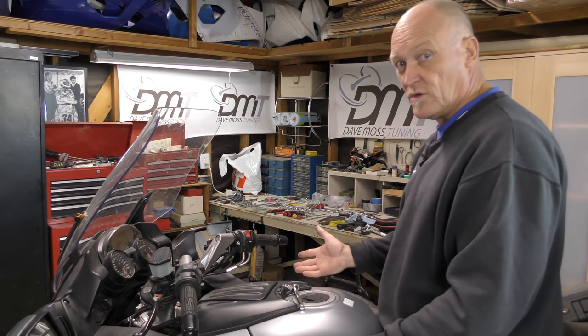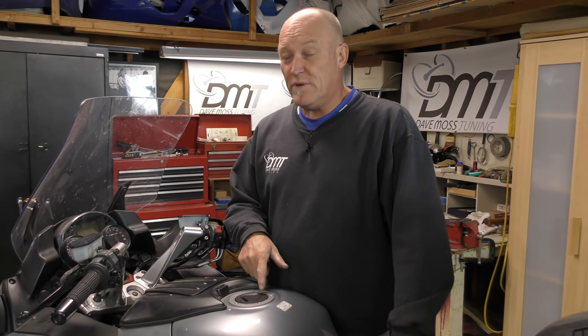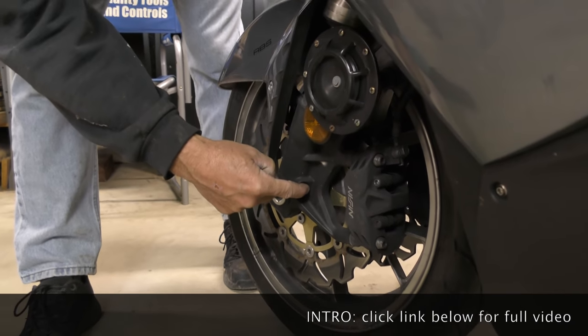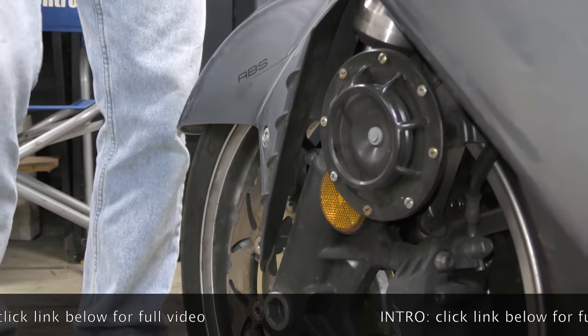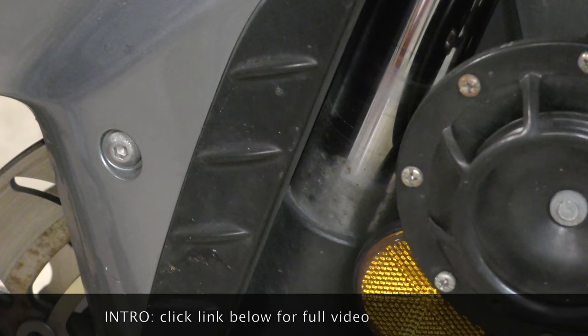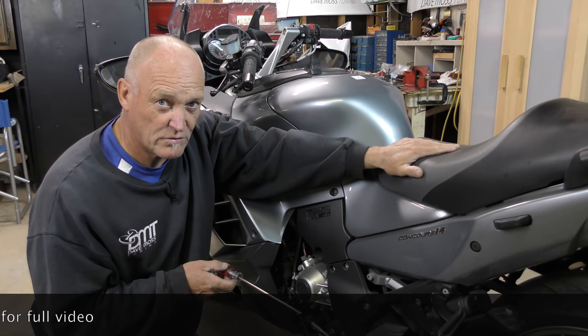Ergonomically, there's the review of the Concours. Long term, let's see what I've got to spend. I've got to figure out where my settings are first so I understand what I've got — whether it's stock or not, it's my bike now. At the bottom of the fork it is blank, so we have no compression adjustment whatsoever. From the travel being used when ridden, it's a lot — we need to understand if that's actually bottom-out. A little more research to do on rear shock and handlebars, and we'll see what we figure out.